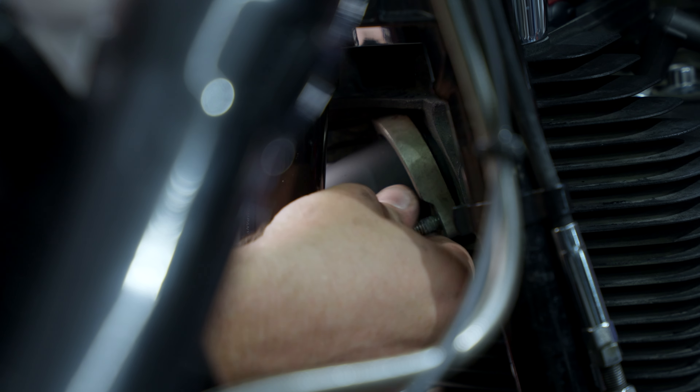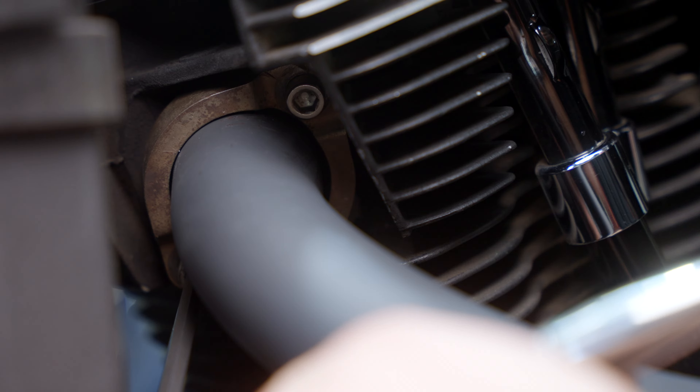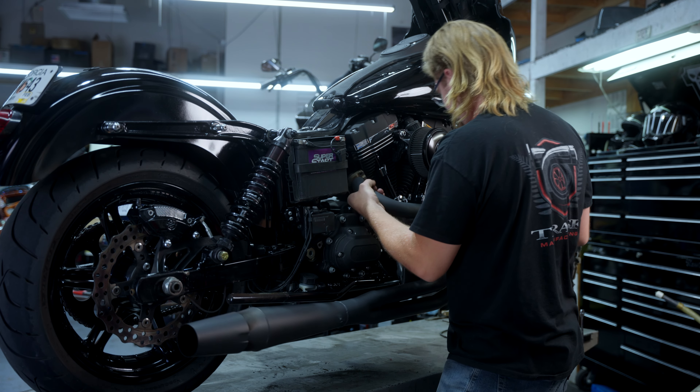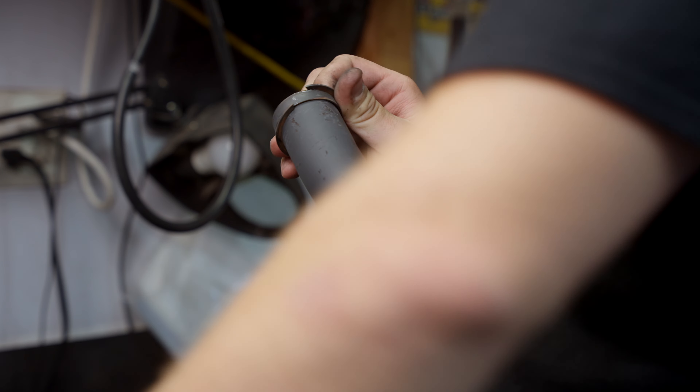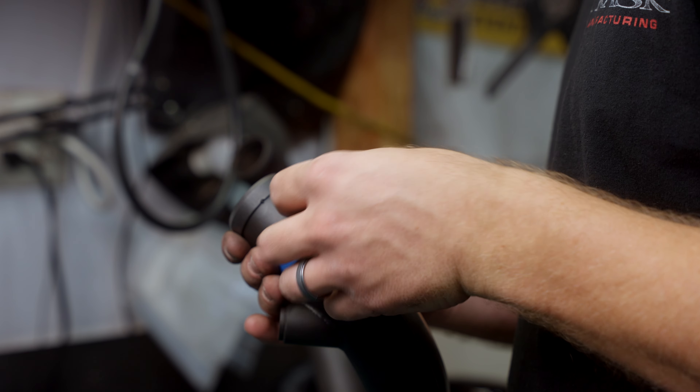This particular bike, for some reason, somebody put socketed down screws in there. Your bike, if it's in its OEM condition, would have 5/16 studs with flange nuts. Remove all four of those, whatever is connecting the muffler to the support bracket. Remove and discard the pipe, but you will want to retain the snap ring and the flange to be installed on the new Trask Assault pipe.